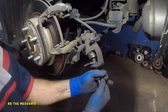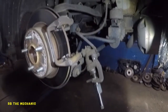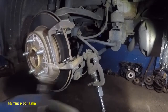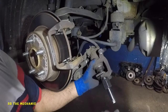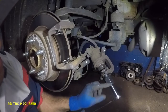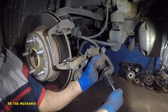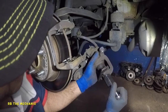I'm going to turn this caliper — I need to get a 14 millimeter. I'm going to put this 14 millimeter on my tool here and turn it clockwise. As this rotates, the tool is also grabbing itself, so it's compressing and turning at the same time. That is the way to compress this caliper. I do have a video on how to compress this caliper specifically.